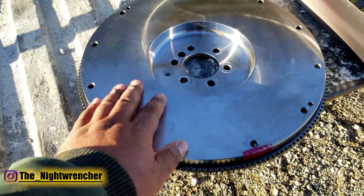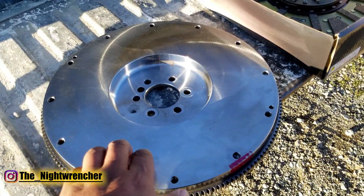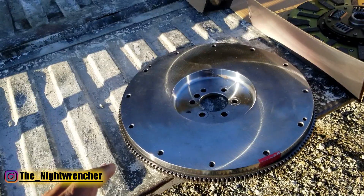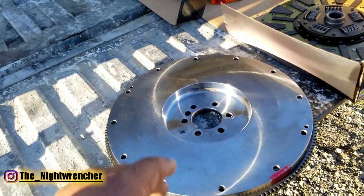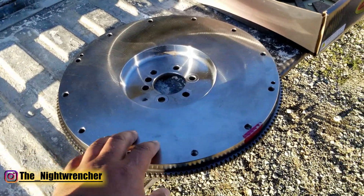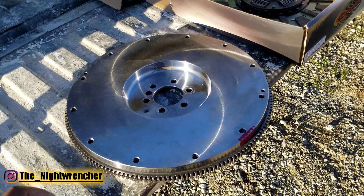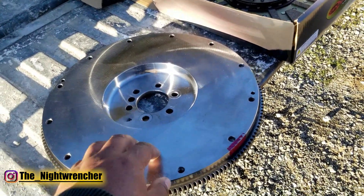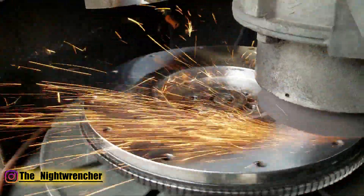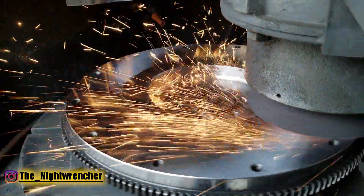While picking up that clutch kit, I also had Center Force resurface my flywheel, because whenever you replace your clutch, you're going to want to resurface your flywheel. This is very similar to your brake system — when you hit the brakes and your car shakes, that's because your rotors are warped. Same basic thing: when you let off the clutch and your vehicle shimmies and chatters, that has to do with the clutch disc skipping against the flywheel. So in order to get full, proper engagement and break-in, I had them surface the flywheel.